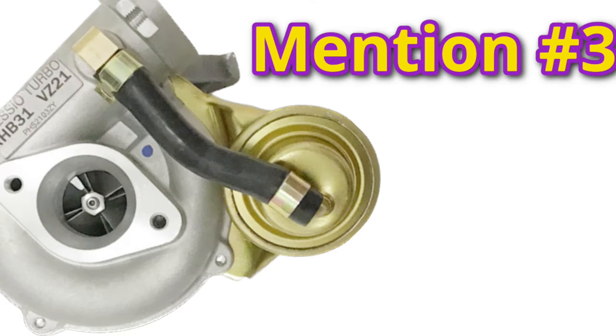Turbocharging: while turbocharging is very common in the car scene, it is a bit more complicated with smaller engines. A turbocharger or supercharger requires pressurized lubrication, which is very complicated with a motorized bike, requiring a completely separate lubrication system. It also requires a lot of tubing and fabrication, making it pretty unreliable and not very effective for making good power, unless you are truly eager for performance.